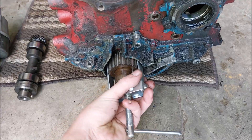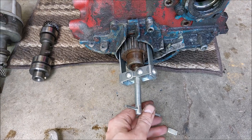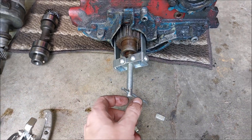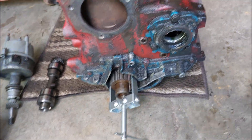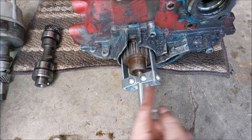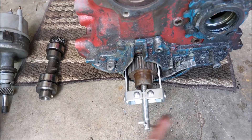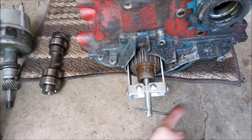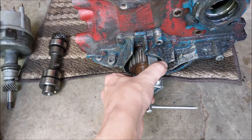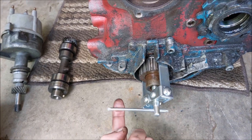Then you just turn this thing — I'll put it on the crankshaft, it's just smaller than the bolt — there it goes. I'm going to go get a bolt, a grade 8 bolt, that's a little bit longer and has a head on it so I can use a small impact to make the gear pulling much quicker. All you've got to do is hold it so it doesn't move — obviously it's easier with two hands — and then spin it in.